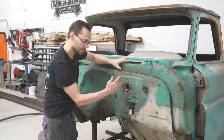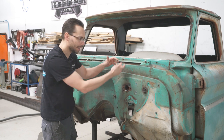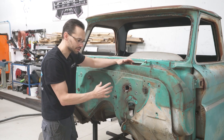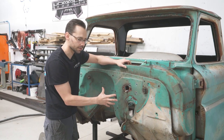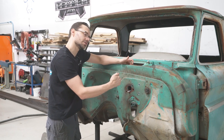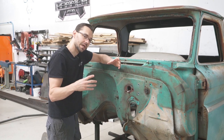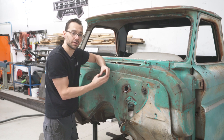There's a bracket that has two arms that go back, and there's a swing and pedal assembly, and it mounts to the dash and all this kind of stuff. It's a structural part of what's going on here. And so we need that, but because the firewall is going back an inch and a quarter, we need to chop that bracket and section it and slide it back an inch and a quarter as well and re-weld it